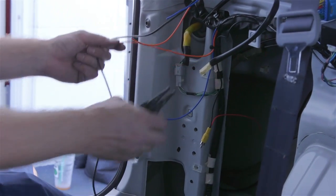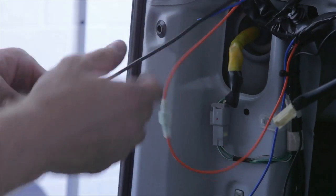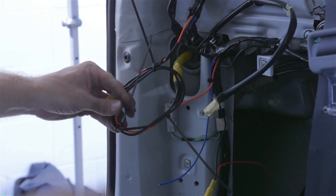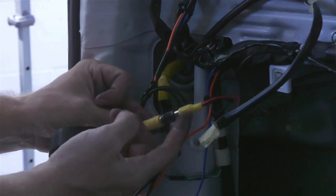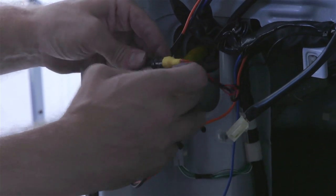The one we'll leave open for now is the reverse — we have the battery disconnected so we actually have to test for the reverse light before we make this connection. We'll go ahead and tape these wires off, make the RCA connections using a barrel, and then tape them so there's never a chance for them to back themselves out and become disconnected.